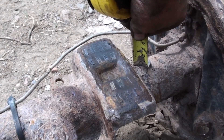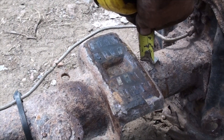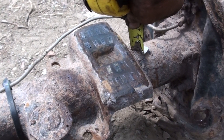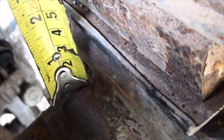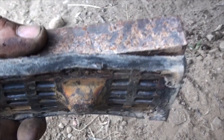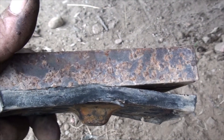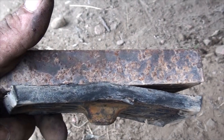I've run into another difference — it may be a problem for you. The leaf spring perches on the old axle have about three-eighths or a half-inch rise, but the spring perches on this axle have at least an inch in height. That means I can remove the one-inch lift blocks I made to level out the van when I lifted it. This is going to work out perfectly for me, but you may have a problem with a tilted van if you don't do something about the front or change the spring perch height.